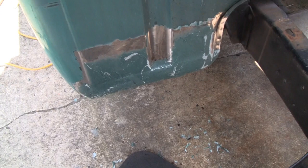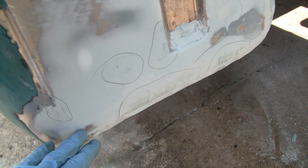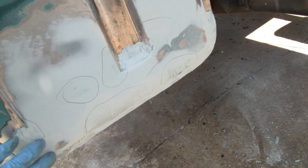I'm going to get a DA and shape this — knock most of that off — and then we can throw a thin coat of filler on there and we should be done. Looking pretty good. We got the shape — nice smooth edge down here. We got a few low spots right here, right here, right here. We'll fill those little spots in and then we should be done. There's really not that much plastic on there. Here's a high spot, high spot, high spot — that's all bare metal. Although it looks like a lot, the plastic is mostly paper thin.